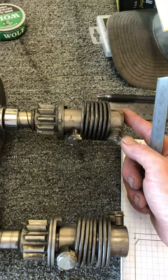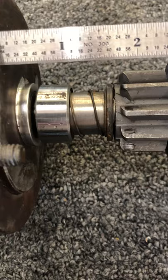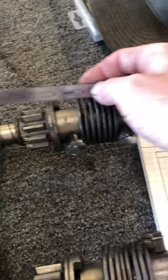There are quite a few differences between these two starters. The first difference is the referencing step, which you can see here. The referencing step on a factory Ford starter is about 1/16 of an inch, and the one on the Power Master is about 3/32 of an inch — which isn't really a problem. Then you get into measuring the snout, the shaft of the starter.